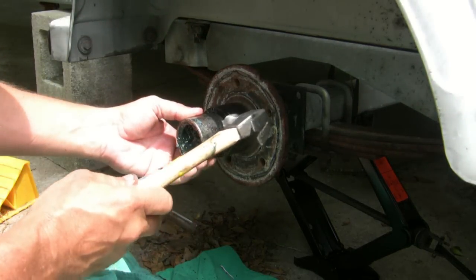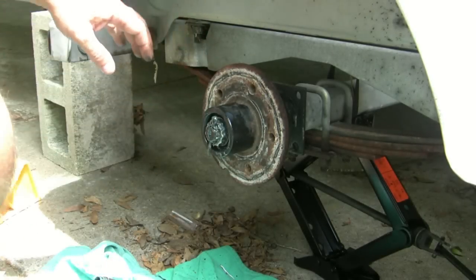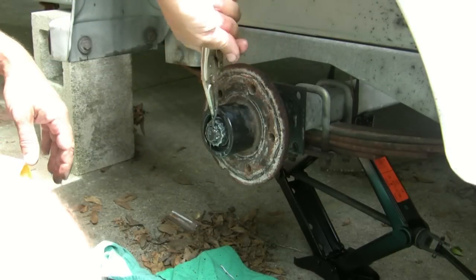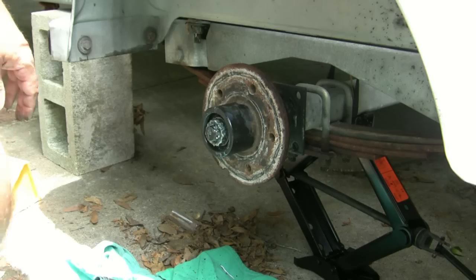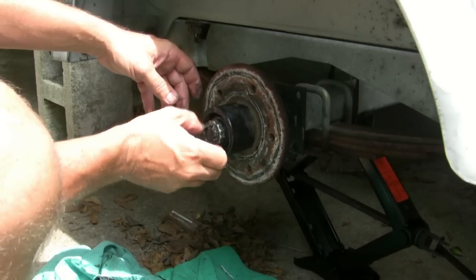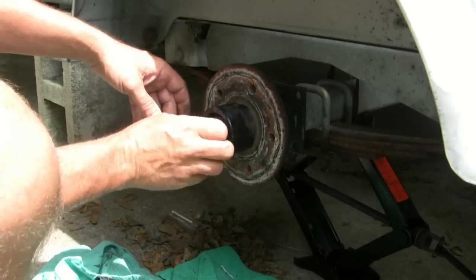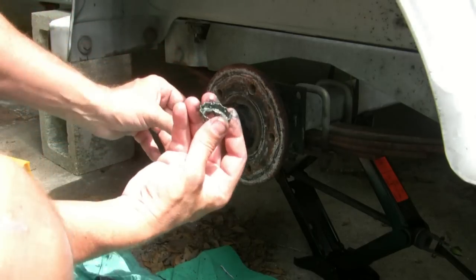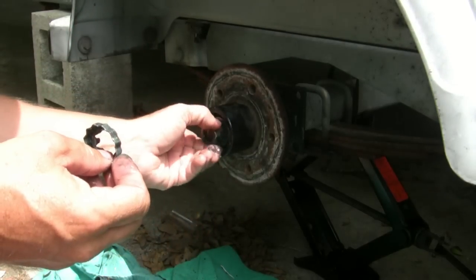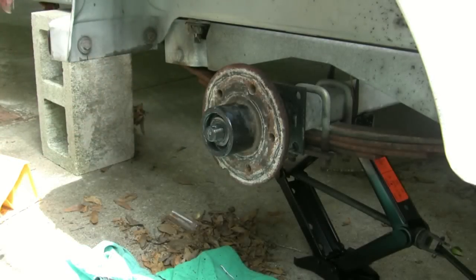I've got it half off already — you basically just rotate and the bearing buddy comes off like that. I already straightened out the cotter pin on the castle nut. Straighten it out first, pull that out, and just turn the castle nut guard here. This one's got a little guard that goes over the nut that keeps the nut from turning — a little thing that goes over top of it, which keeps the nut from backing off. Take both of those off and keep putting that stuff in a clean spot.